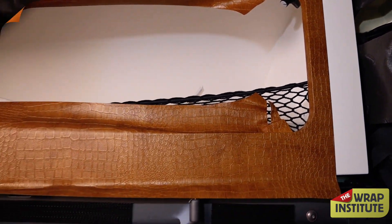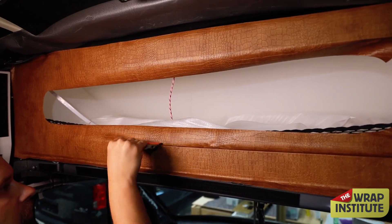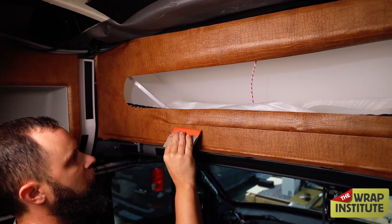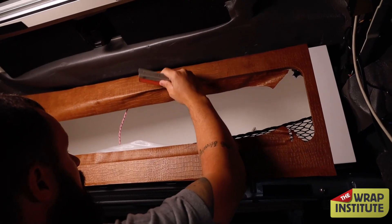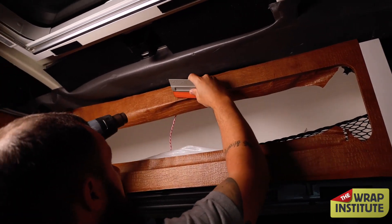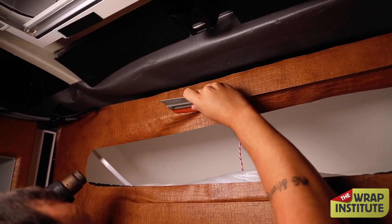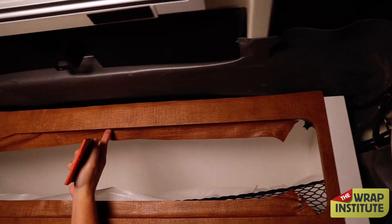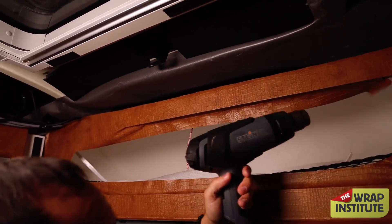Here's a close-up of the mouth where you can see everything fed with nice, even tension distribution — awesome. Now it's very important to round the film around this 90-degree turn at the bottom. He works in baby stages, gives it a kiss of heat, uses zero stretch to shrink it to that upper corner, then locks it around the corner. You can either work in stages, pac-man it, or run a finger. He uses the wide buffer on the squeegee, which rounds the corner like a finger, feeds it to the edge, and works it through the mouth. The other side is exactly the same.